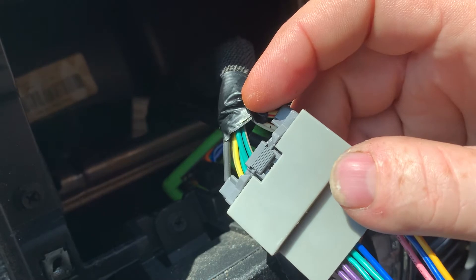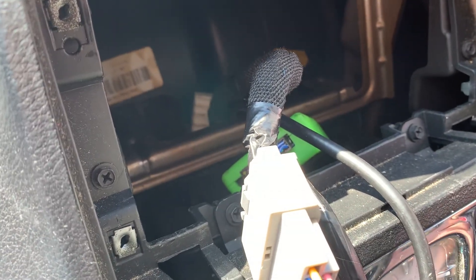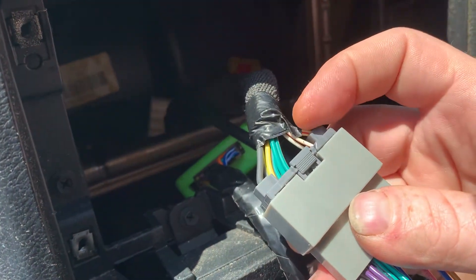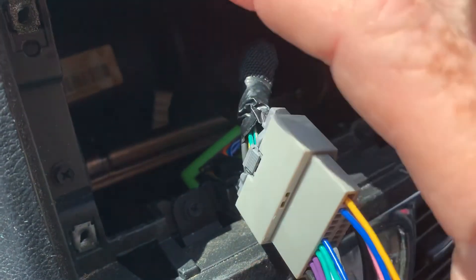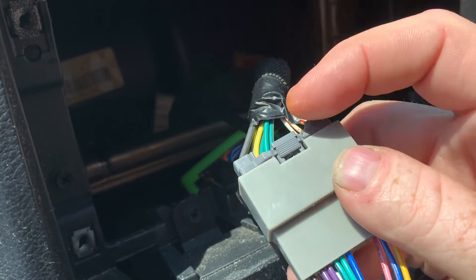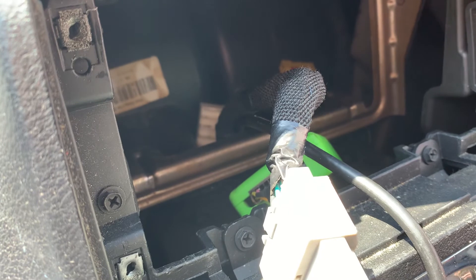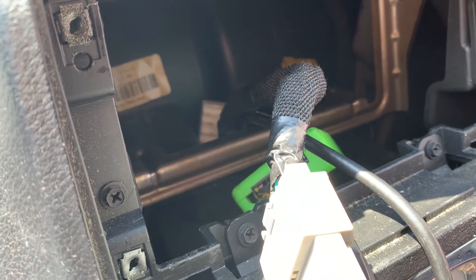I think it's a short in this wire from the ignition somewhere, and in all honesty it probably stems from the ignition down here — the accessory switch on the ignition — because it's happening in a bunch of vans. If it were just a wire issue, it wouldn't be in every van. So bypass that wire. I'm not telling you folks what to do, just what I would do to keep from buying another couple-hundred-dollar radio. It could also be stemming from the backup camera, but that wire is what's causing my problem. I'm bypassing it and using a different power source, and so far so good.